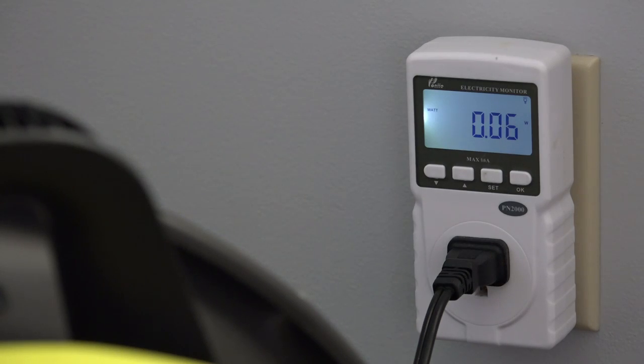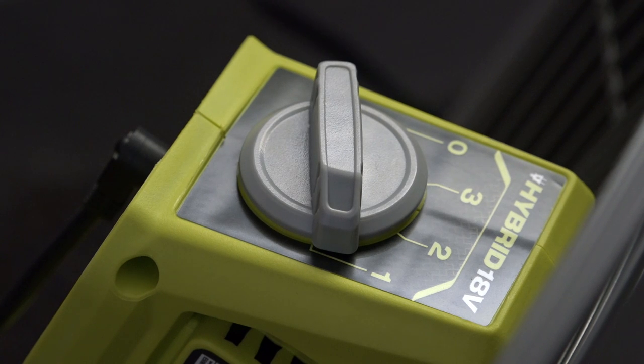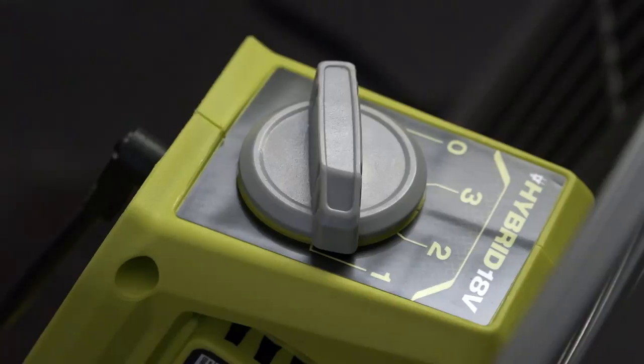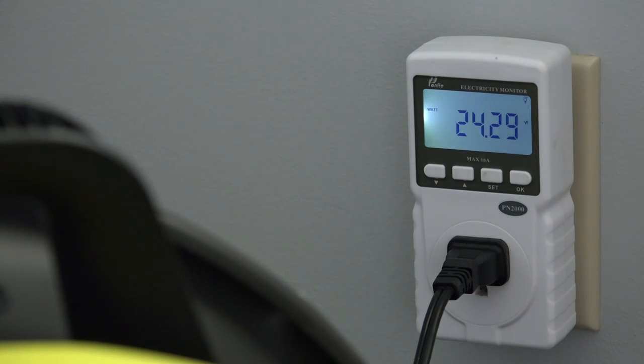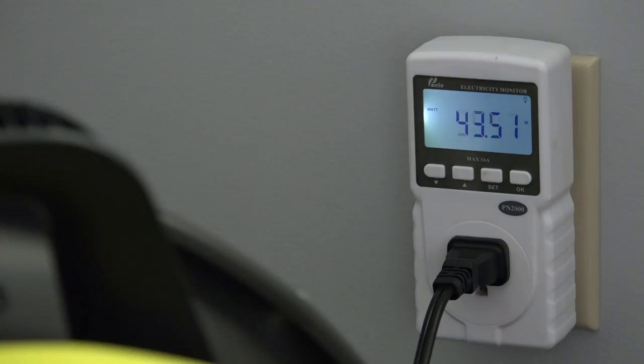With a power meter, let's review the power draw for each fan setting. We'll start at the lowest setting and progressively work our way up. At setting 1, the fan only pulls 15 watts — impressive for a fan of this size. Moving on to stage 2, we have a bump to 25 watts, a 66% increase in power creating 32% more air movement. Finally, stage 3 pulls 55 watts, which is an additional 120% increase in electricity while providing a 24% increase in air movement.